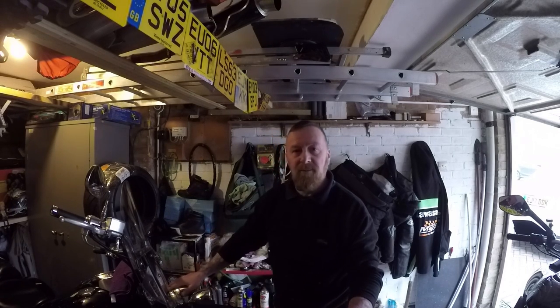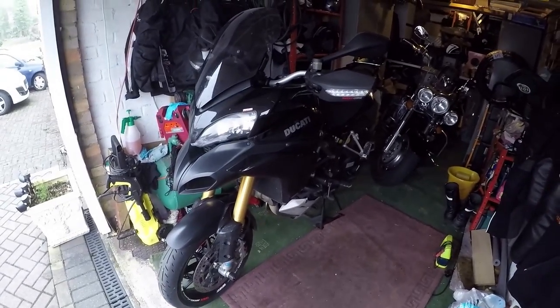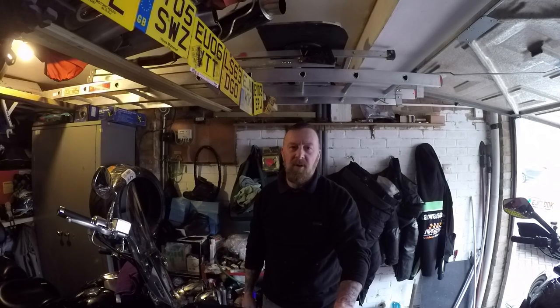You may come back the next day though, if you took it out and left it somewhere overnight — it's had all that time to settle and the amps aren't quite there — and you get non-starting or very slow starting. This is the problem I'm having with my Ducati now. Give her a charge and after about three days I'm noticing she slowly starts to start, and at work I'm getting a 'rrt rrt rrt' noise — you're never quite sure it's going to go or not.